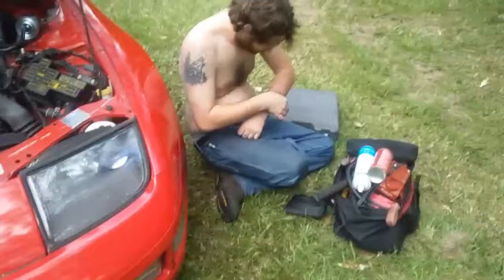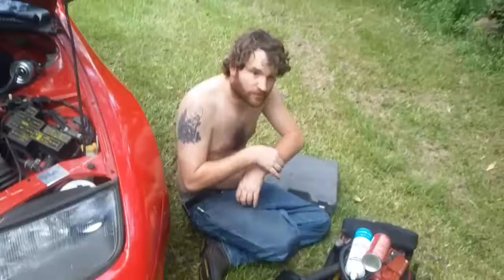We are back. I got stung twice on my arm — we got wasps. We got everything buttoned back up: the booster and balancer are back on, fuel filter's in, plugs and coil packs have been inspected, cleaned up a little, and put back in. Checked all fluids again, put the battery back up — fixing to give her a crank and see what happens.